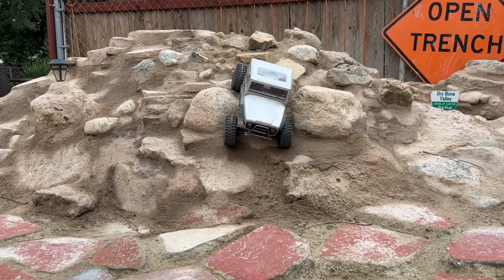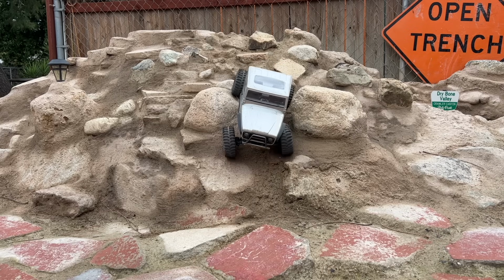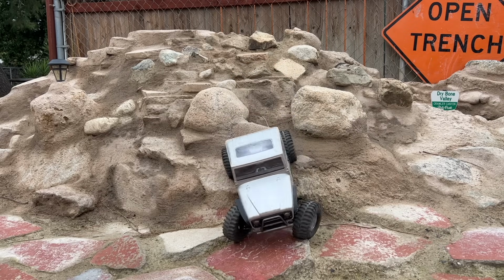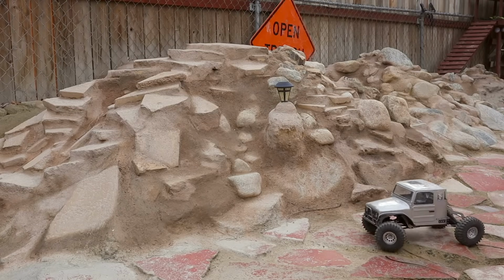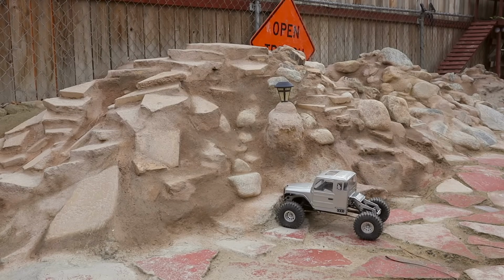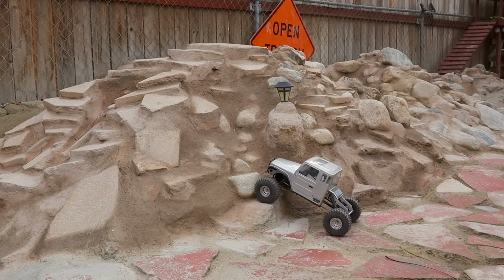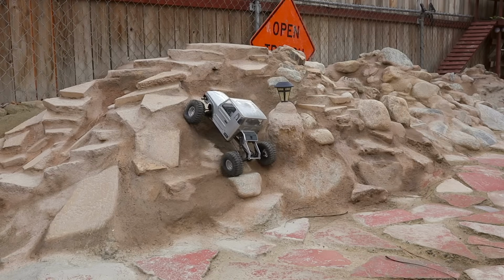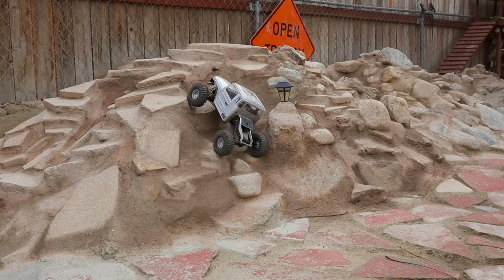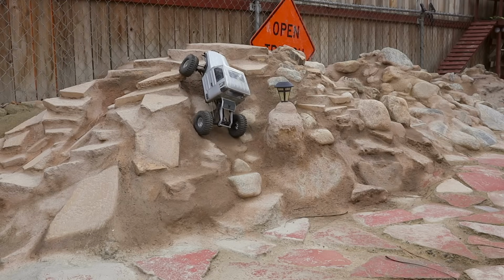It would rock the tie rod up too far and interfere with the servo. So I try to get my drag link and my tie rod nice and parallel at rest on a servo on axle. And that's where we ended up. I have zero complaints about how this dude is driving. The holds are doing the work.